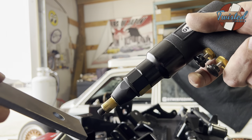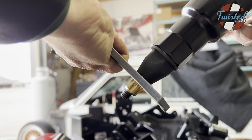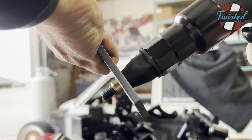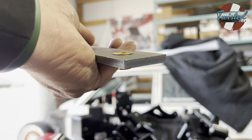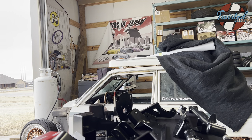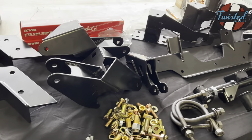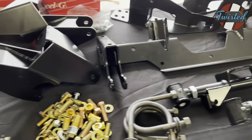Basically, you have a thread-in and thread-out button. You stick it through the hole, hold it firm against there, and squeeze — once it stops, it's tight. Back it off and it's just locked in. It saves so much time versus doing them by hand. That's one of my big tool recommendations. Most of the rest of this kit can be installed with basic hand tools, but if you can swing it — tell your buddies to go in on it with you — that thing will come in handy. It'll change your life. That's basically the kit right there.